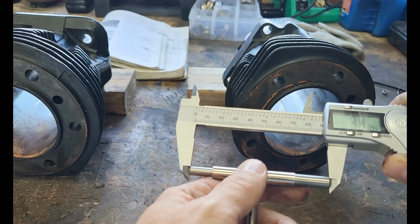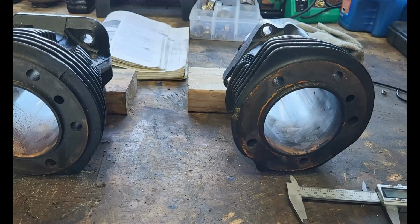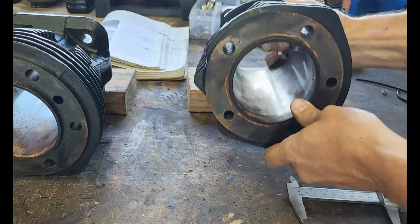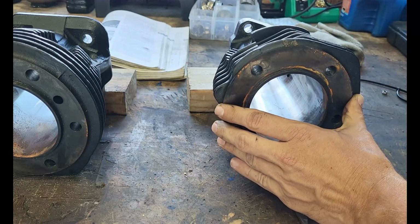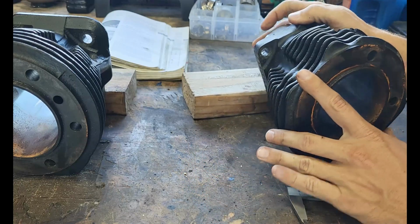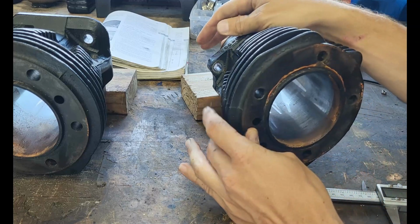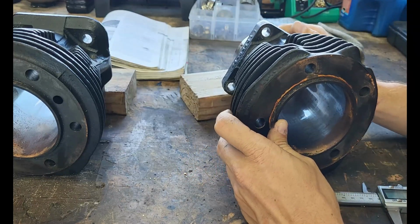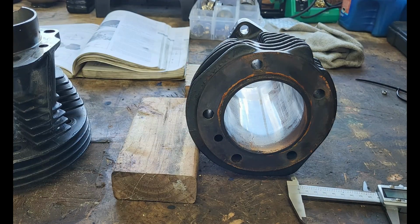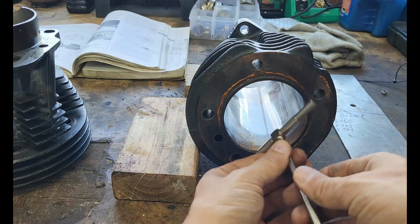And this one we are 3.464. So at this angle, or I had this set up this way, this one's true. So let me find my other marks. Move these marks 90 degrees off. There we go. Beautiful. All right, so let's take these readings 3 more times, and then this one will be ready to crosshatch.